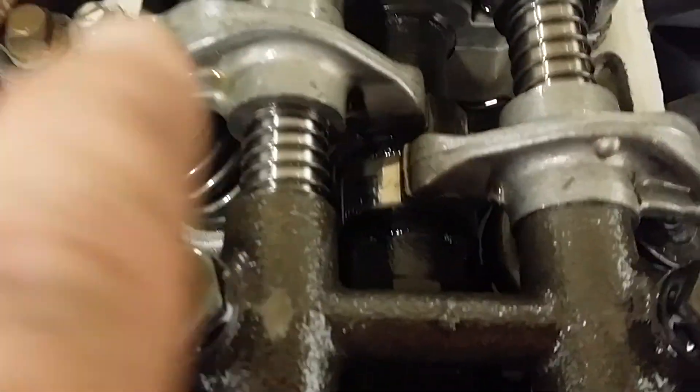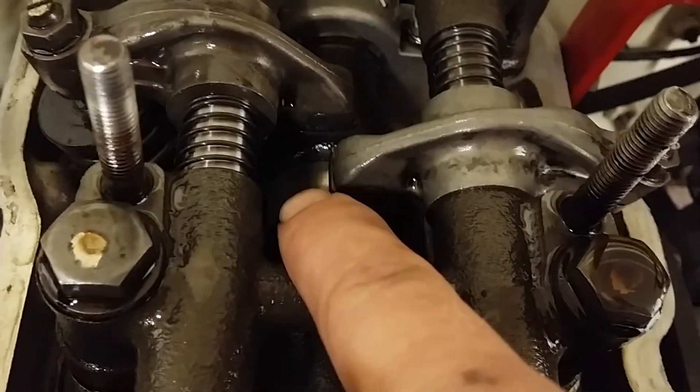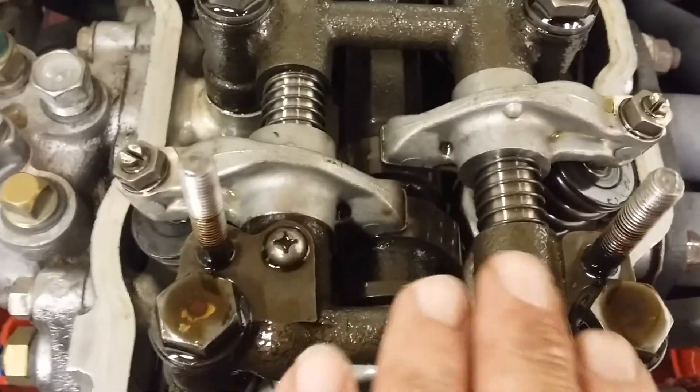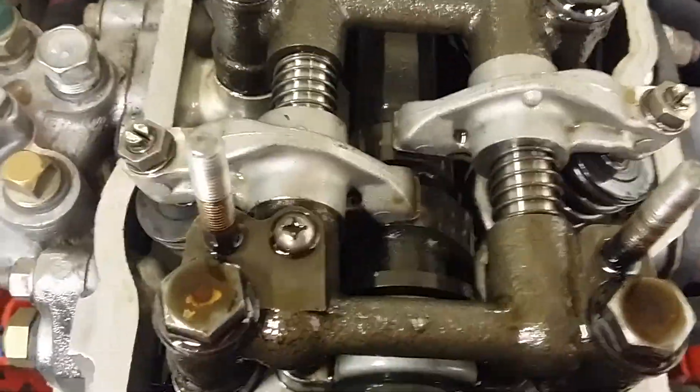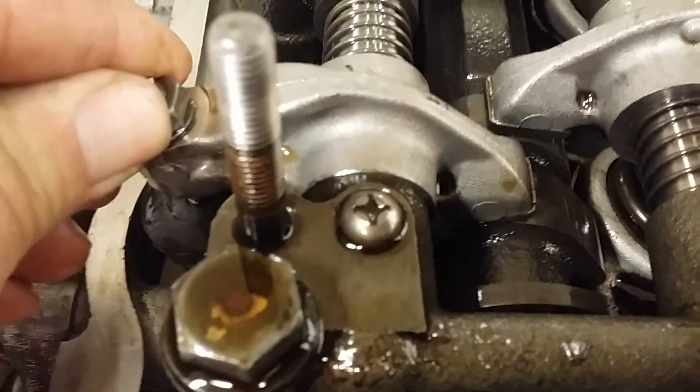That's a lobe — it's raised. A lobe is up, and the bottom is down like this one here. This one is not on the lobe, so this one would be loose. I just adjusted them; it's not too loose. So you can follow a sequence, or you can just make sure they are exactly at top dead center on that cylinder, which will be not on the lobe of the cam. That's when you want to adjust them. You can hear the little bit of play that I just adjusted, and it's not on the lobe of the cam.